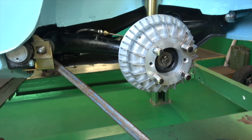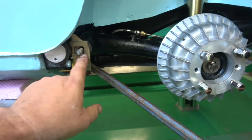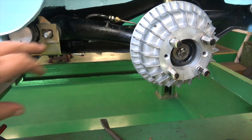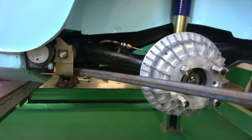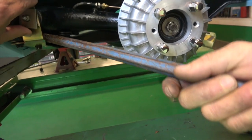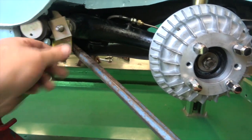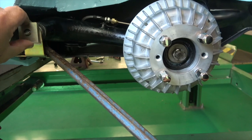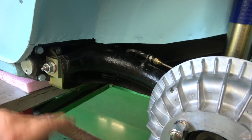This is the new bracket that's on, and you can see where it's lying at the moment. If you let the tension off, you can see where this can go — you can even pull the hub forward so you can get it fairly central. Without damaging the pin and thread, this is as far as we want to take it up, and that's given us the camber we need. We used a crowbar to lift up the radius arm, and because it's slotted all the way along, it will centralize itself.